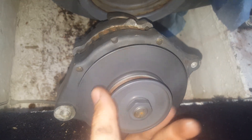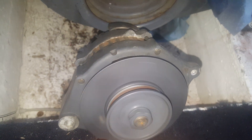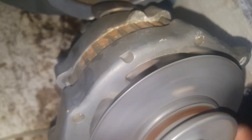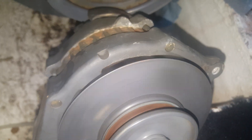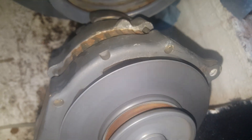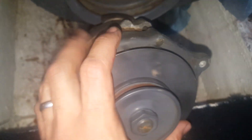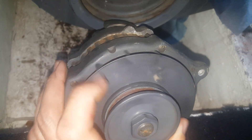We've flipped over to the alternator. I kind of got it isolated — let's get real close and take a listen. It's kind of hard to hear, but you can hear that vibration noise. The bearings on this one are no good.